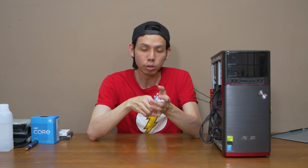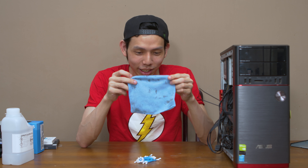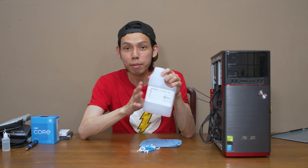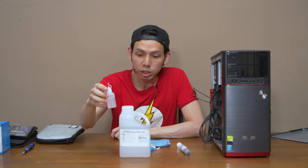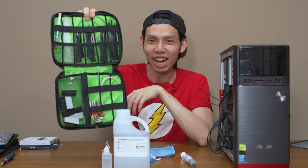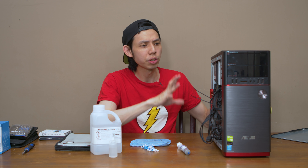Some cleaning equipment I'll use: cotton buds — but use these carefully because there might be little cotton hairs that get caught on the electronics. Cloth — try to use a clean one. Alcohol 99% — it won't damage your electronics and it removes a lot of dirt. Thermal paste — not really cleaning but re-applying thermal paste. I have a small squeeze bottle with alcohol, so that's easier to apply. And last but not least, zip ties. Something that might also help is a can of compressed air to blow out all the loose dust.